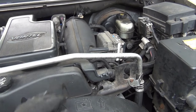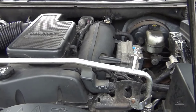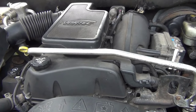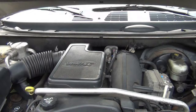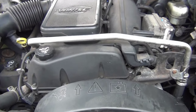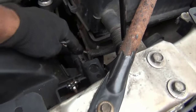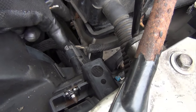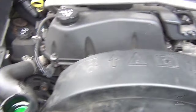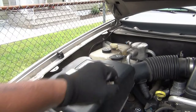And if it's too high, then, if it's okay, sometimes some people overfill the transmission, which is not good, then I'm gonna leave it like that. It all depends. Also, make sure there are no leaks beneath. You check everything. Do not go away when you turn on the car when you do one of these jobs. Also, don't forget to connect this for the radiator fan, I mean, for the fan clutch. And I already put a fuse here. I'm gonna turn it on right now. Put a fuse there too on the reservoir.